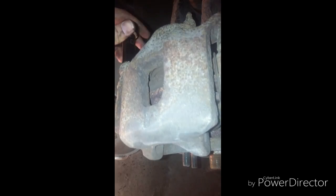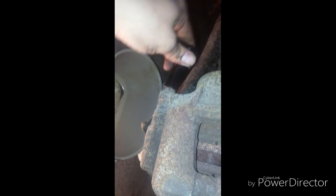If you use WD-40, loosening is a lot easier. Our next step is taking out the calipers. For that, you need two 14mm bolts, so we're going to go ahead and open those next.